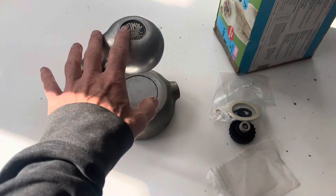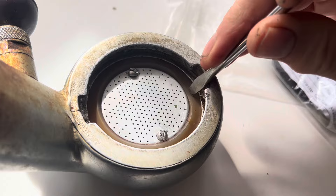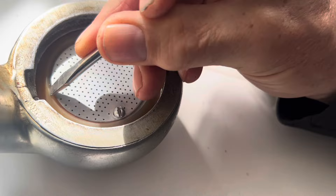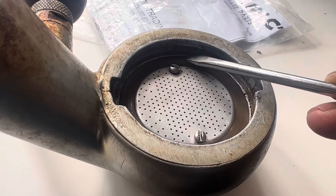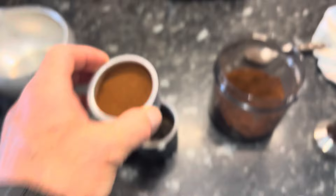Let's put this machine back together and see what it's like. We'll use a new coffee basket because that old one is never going to seal. I'm putting one of the silicon seals in now — you don't actually have to undo the screws to fit it. You screw the plate in first, press the seal down, and then lock it in place with the group handle. I will clean out the channels with a Dremel tool, but first I just want to see where the machine is leaking. I'm struggling to get that seal to sit flat, so I'll try making a coffee anyway.